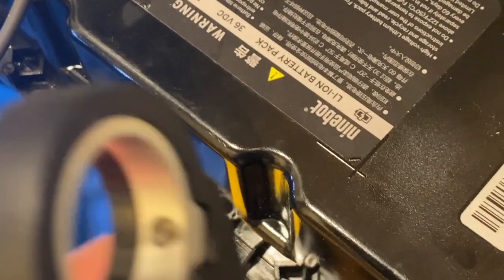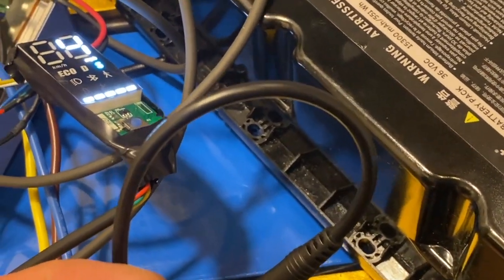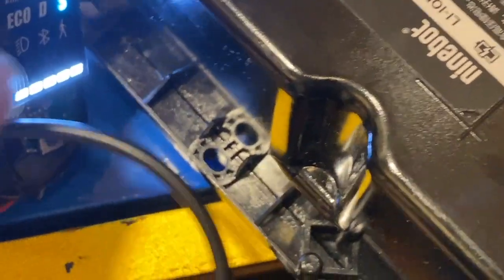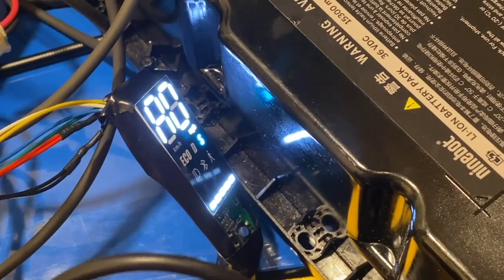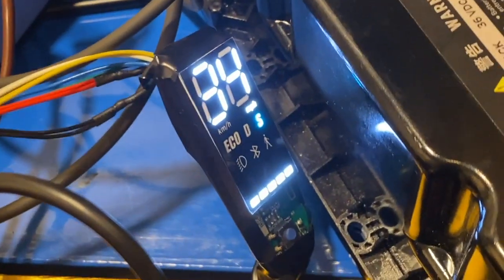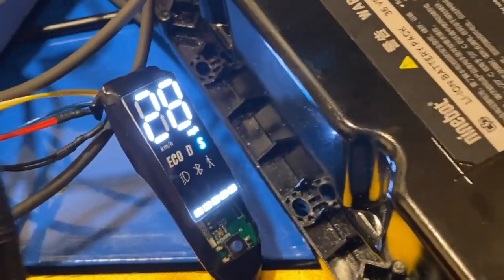I have my setups done and the battery is fully charged — let's see how this motor runs. We are talking miles per hour. The stable speed is just great. And yes, as you can see, that's 34 miles per hour on freewheel on 36 volts. With load, this motor is going to hold about 28 to 30 miles per hour.